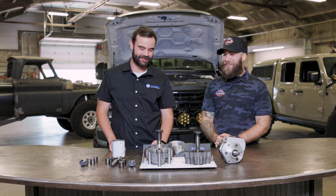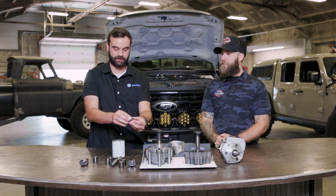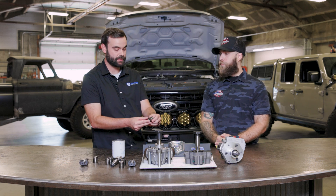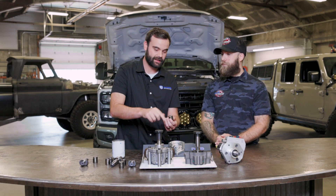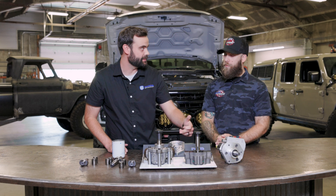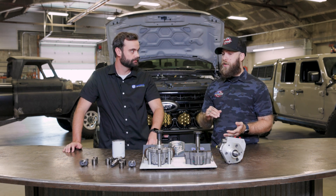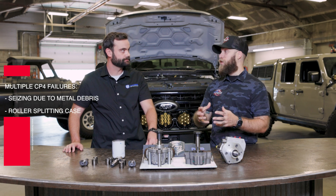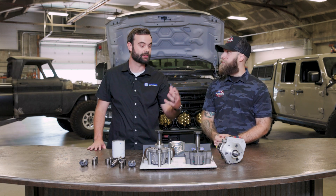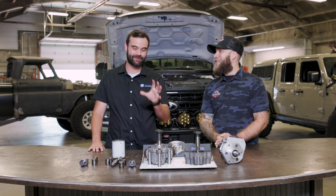It doesn't help that they're super sensitive. It all comes from that bottom end interface — aggressive two-lobe cam design with the rollers and the buckets. We've even seen these buckets rotate and ride sideways on that cam, causing metal debris. There are so many types of failure: the bucket can fall out, or the roller can fall out of the bucket and get lodged in the pump. We've seen pump cases actually split because instead of the cam pushing the bucket up and down, it's trying to push it out — creating enough force to split the case. There's also a failure where it seizes from heat and shavings, and then actually physically grenades from that roller falling into the pump. In select cases we've even seen it spin the crank gear — and that's a whole new level. That's why it's very imperative to stop it before it becomes an issue.